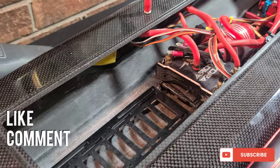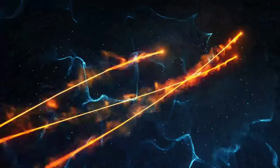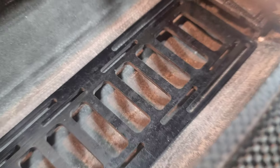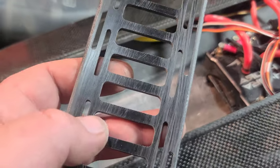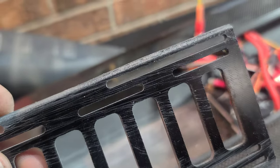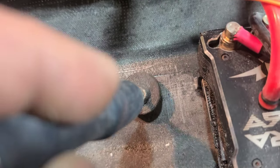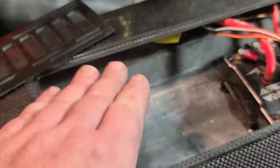Electronics trays in the boat — might not be the right way but it's Big B's way. I've been prepping it up to save some time. I sanded all the old stock adhesive off, got it down to clean carbon fiber. Did the same thing with the hull — took my Dremel with a grinding wheel on medium-low speed and ground that black adhesive off both sides, down to clean carbon fiber.